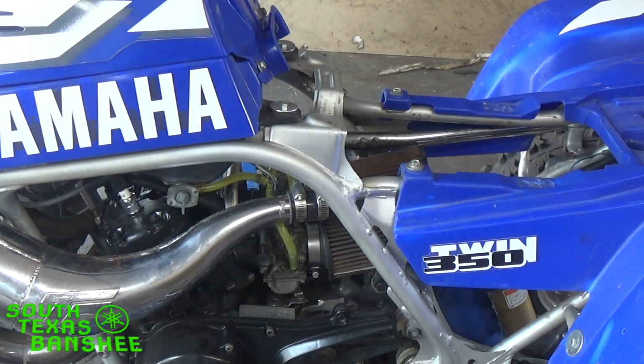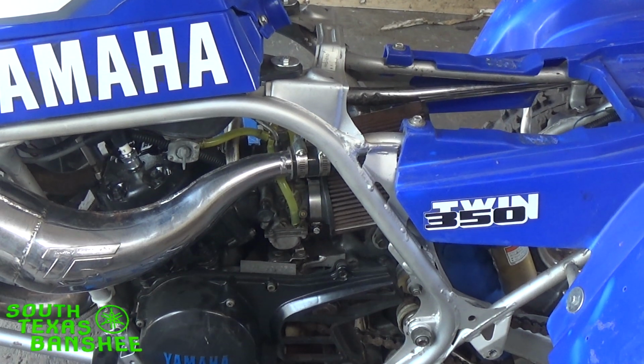Another month, I get down into the 60s in the morning. I'm going to run out of adjustment. I'm going to have to close those air screws up all the way, and that still might not get it. Then in the dead of winter, when we get 30-degree days, maybe cooler than that, the idle's going to hang like crazy and it's not going to run worth a crap. It's going to bog and all that. So at this point, I'm going to leave it alone.